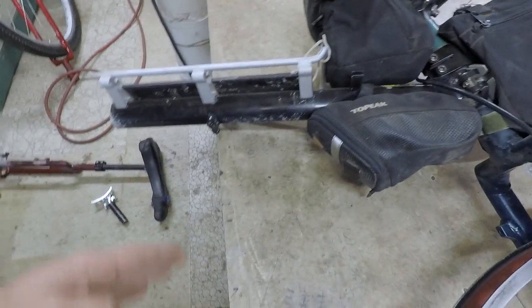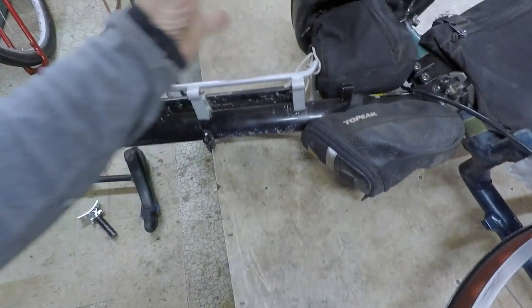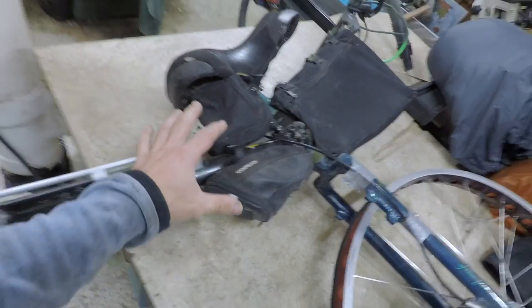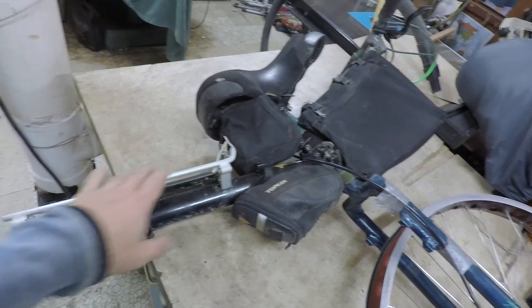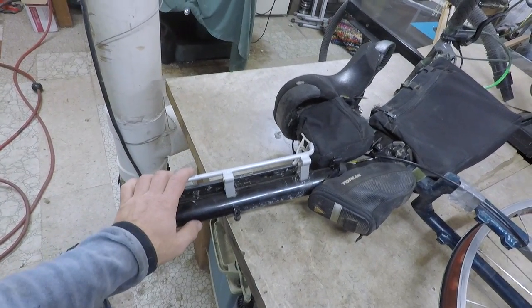Ideally I would make another rear pack that would hang underneath here — that would be perfect to have more weight on the unicycle. Because I like the weight to be really close to the center of the axis of the unicycle. The closer the weight is to the center of the axis, the easier it is to ride. The further the weight is out in the back of a rack, the more side-to-side sway you'll get and the harder it is to ride.